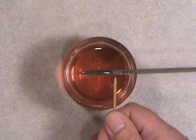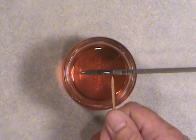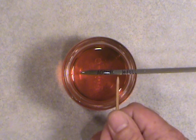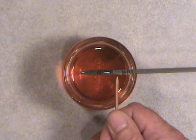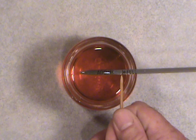I know I have to put in about a liter or a US quart of oil to top that up, but just add a little bit at a time, reinsert the dipstick, and take another reading until you get it to where it's at the full mark again. But don't go over full. Once that oil's drained back into your oil pan, never go over the full mark.